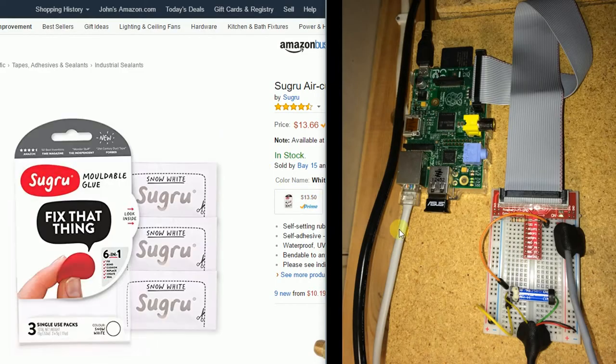Here's an idea of how I have my hardware hooked up. This is the side wall next to my bar fridge — a vertical wall with everything mounted to it. Half of the Raspberry Pi case is screwed to the wall and snapped in. I'm using two-sided velcro with adhesive behind the breadboard. The GPIO breakout boards are really cool because they make it breadboard-friendly — you can find those on eBay or Amazon. For the wires hanging down I wrapped a bit of Sugru, a moldable rubbery compound that cures in about 24 hours, for strain relief to keep the wires from pulling out of the breadboard.